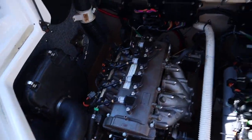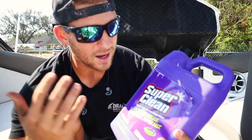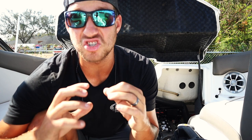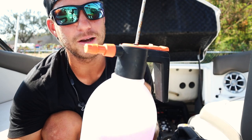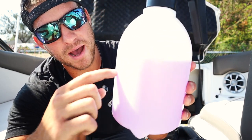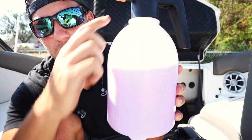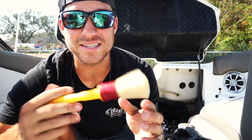Before we get into the teaching, let's go over everything you're going to need. First is your degreaser — Super Clean has become my new favorite. It's super strong but not overly aggressive where you'll mess things up. You can use it straight for super heavy jobs like nasty vinyl seats or motors. I used this pump sprayer — I bought this at Sherwin-Williams but there's a link below for another good one. I filled it to about 50/50 dilution with water. This is what we'll use to clean all the oil, grease, and dirt out of the engine room.